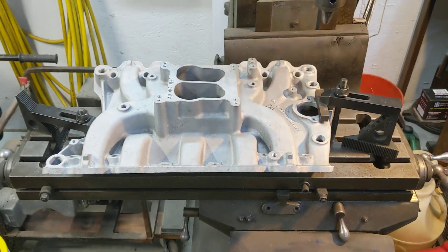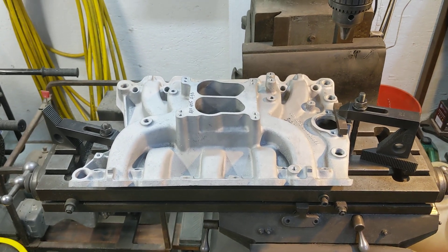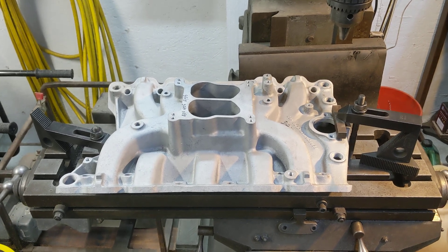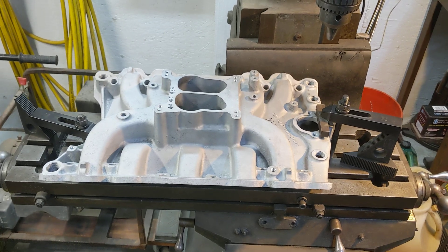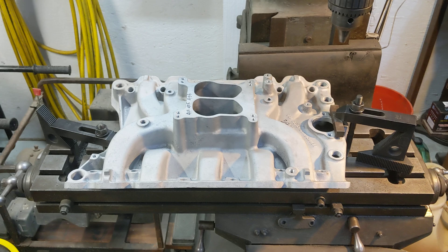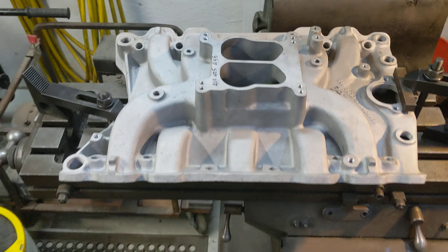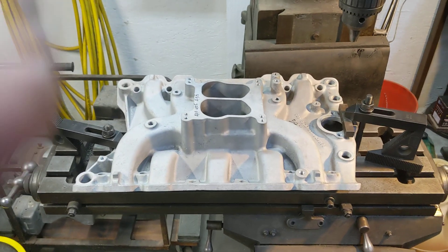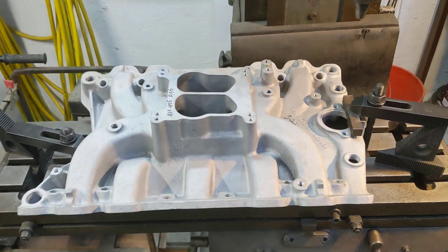I'm a cheap ass — and that's why I didn't buy the eleven or twelve hundred dollar aluminum intake manifold that's readily available from Applied. It just seems crazy, but they have a limited market and they're trying to get every dollar they can. Having increased runner length — which this will have over the Applied unit — will increase the torque. So that's a good place to start.